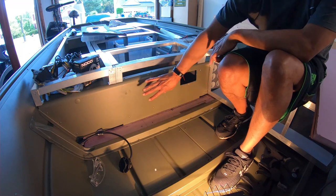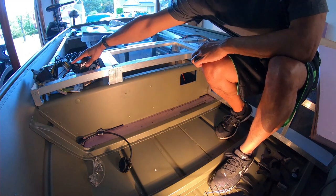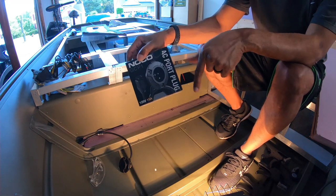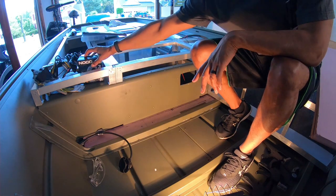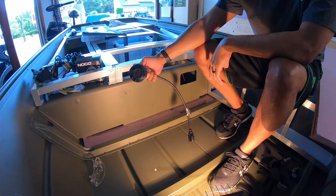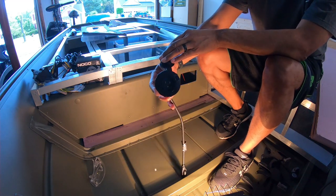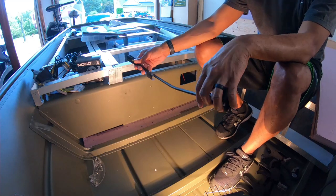One last thing I need to cut out will be the port for the charger, onboard charger. And the one I'm going with is this one right here. It's an AC port plug. I'll leave a link in the description below so that you guys can check it out. And how it works is, instead of having to run a power cord into your hatch or wherever your onboard charger is, you just go ahead and install this guy. And it's a basic port that you can plug into. This end looks like a regular plug that your actual charger will plug into.